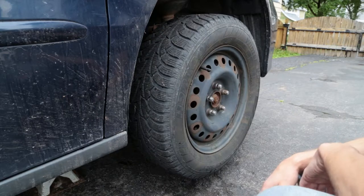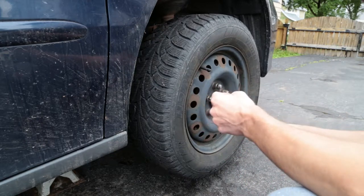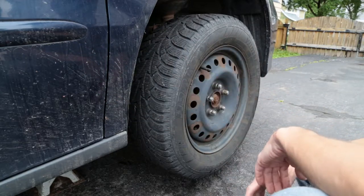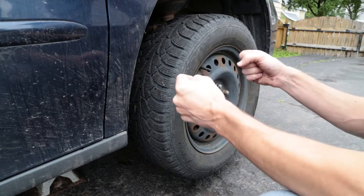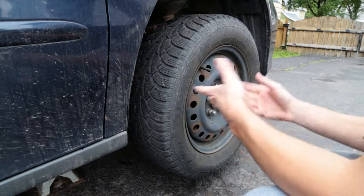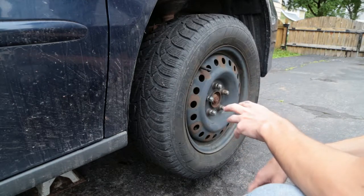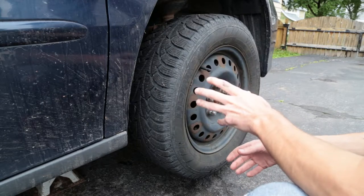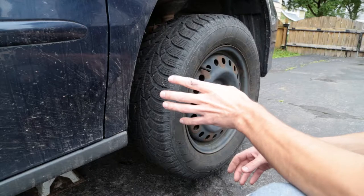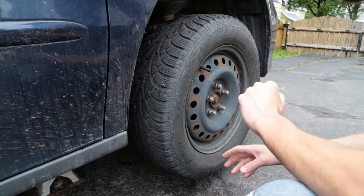There are a lot of indicators when you're driving. If the car tends to steer left or right when accelerating, it's possibly a bearing. If the car wants to swerve right or left when you hit a bump or dip, that means it's a ball joint. Clunks and clanks when you hit a pothole are often the sway bar linkages — but in this case, that wasn't what ended up happening.